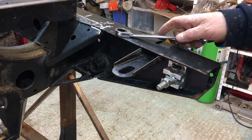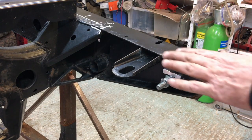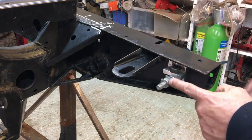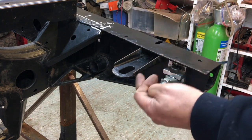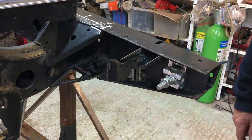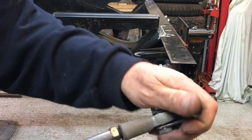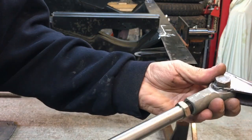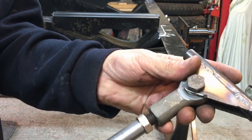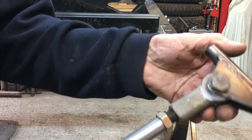There we go — that's on in place now. Another thing worth considering while the camera's here: you've got this exhaust bracket on this side, so make sure you keep this below that because you don't want it getting in the way of your rod. On this end of the rod, this was an old half-inch UNF female rod end. What I've done is turned the head down of a bolt, banged it into this tube, and then put a nut on there as a stop.